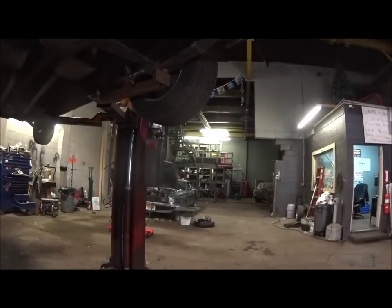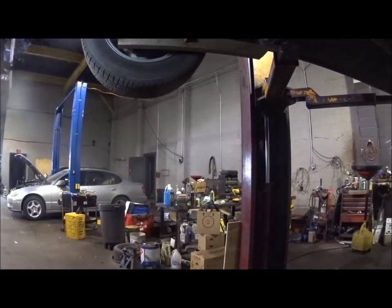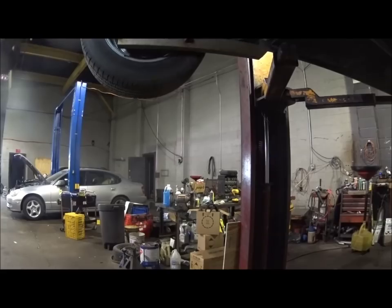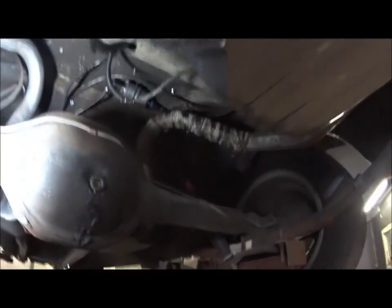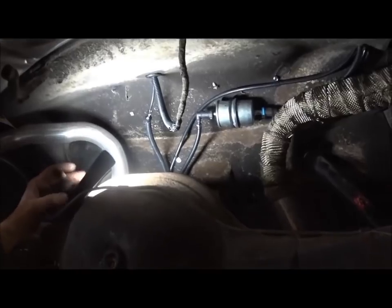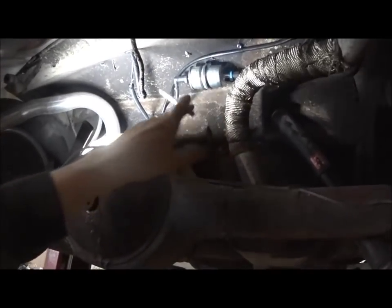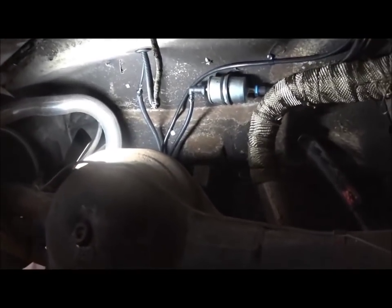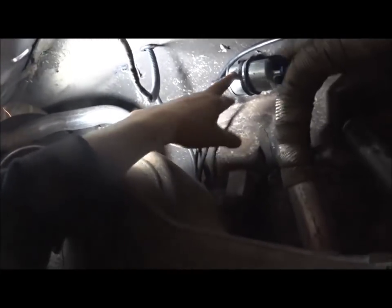Here's the bottom of the tank. There's the old feed line — the owner wants to leave it in in case he wants to revert back to a carburetor. It's not harming anything and it's not in the way, so it's fine — just going to be tied out of the way with a piece of safety wire. Realistically if he ever goes back to a carb I'd recommend replacing that line anyway, but it's just along for the ride. As you can see, there's plenty of clearance between the exhaust and the fuel lines. I did wrap it just for a little overkill safety.